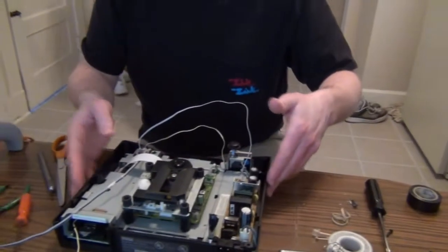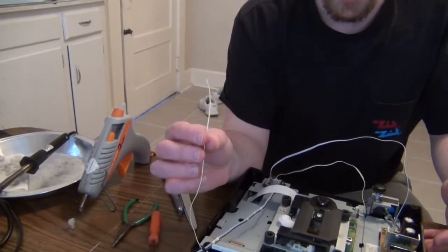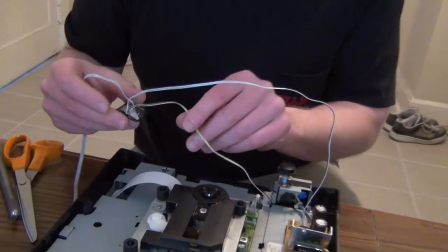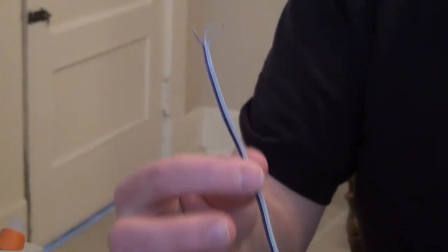All right, so what stage are we at this point? Well, there's the wire for the door switch, so that you can do your swap trick. We've got the little mod chip wired up, snaking out from the underside of the board. Had to wire it to power and ground. Here's the wire going to the switch that we will soon pick up from Radio Shack, and it's insulated on the bottom. Just find somewhere to stuff it.